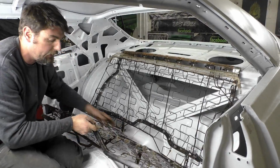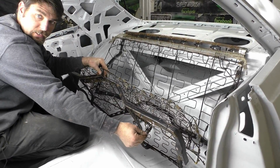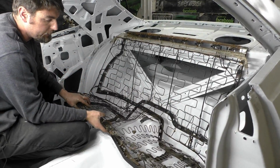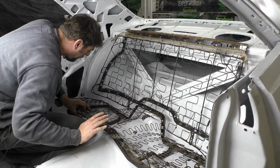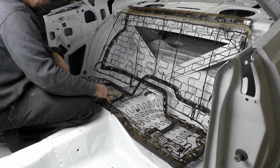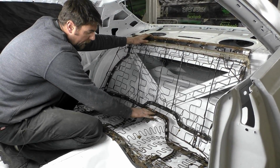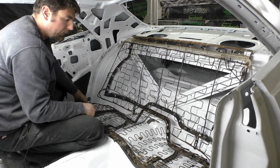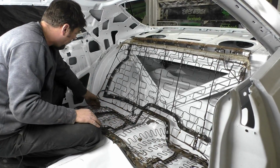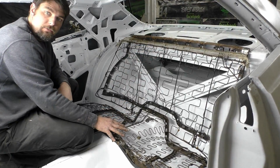So how that's going to go in, like I said, these 2 right here are your bottom brackets that the seat clips in. That's the same for most of these muscle cars. So you slide the seat in there and you kick it forward and it locks in, and there we go. We're pretty much dead on. The seat height here holds the bottom, and don't forget there's going to be padding and everything. We got a little bit of wiggle room, which is what we want when we get the pads and everything on here. So I'm really happy with the way that this seat frame fits.